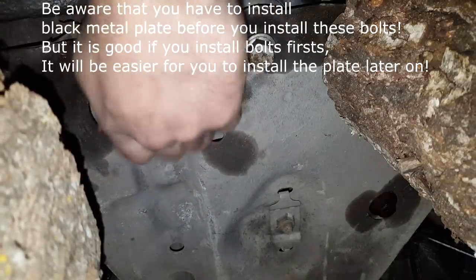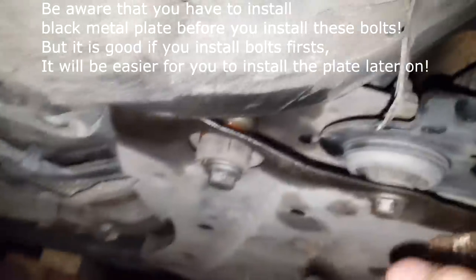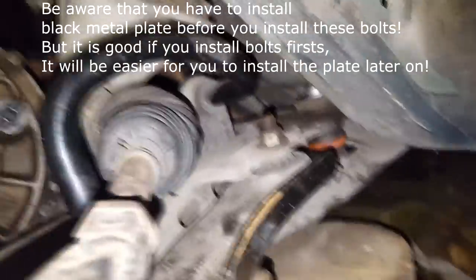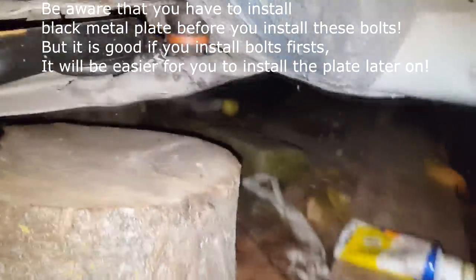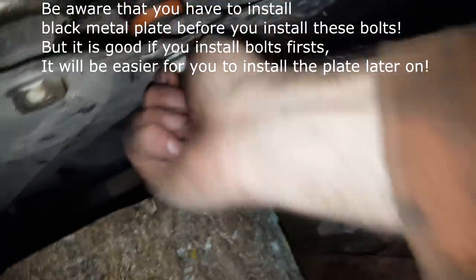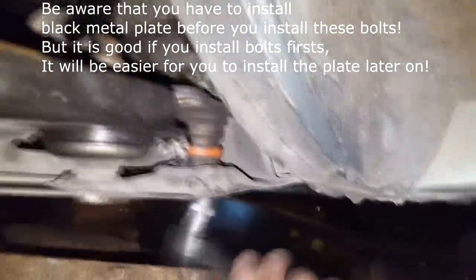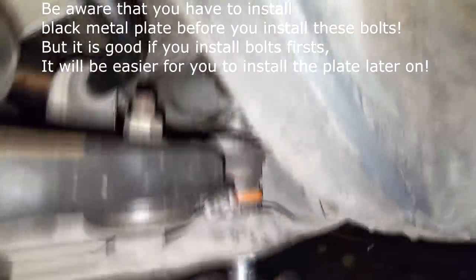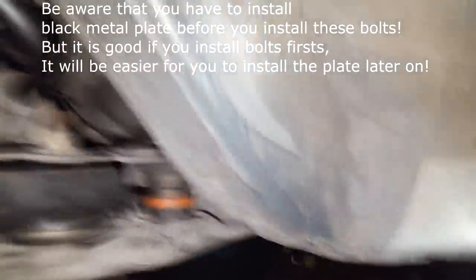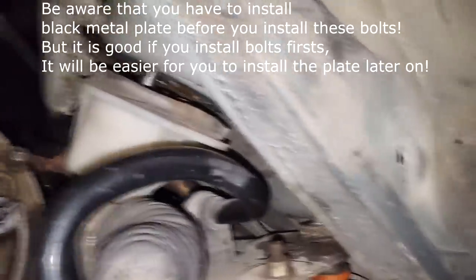As you see, it's not dead center, so it's not very good, but the thing is that I will not tighten it fully, as right now it's kind of loose. I will do the same thing for the other side, so I don't break my steering gear, so I will do them evenly. Just take the other bolt, also I will degrease it. When you look at this one in place, as you are alone, use some help of the wood piece or whatever else you can find there. If you can just put this bolt through, it actually went really good in. Keep checking your position, if it's all right, because you don't want to break your steering gear.